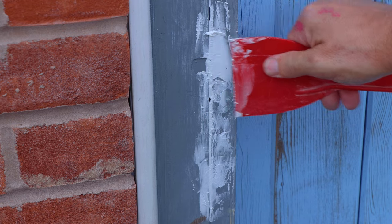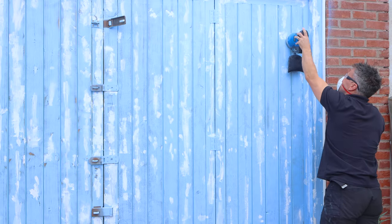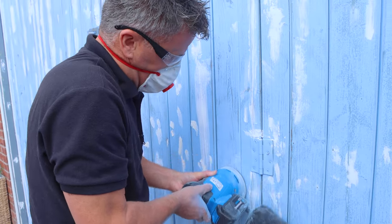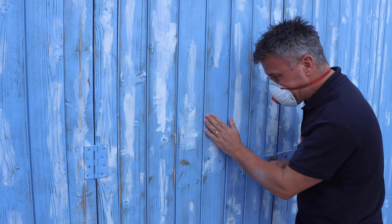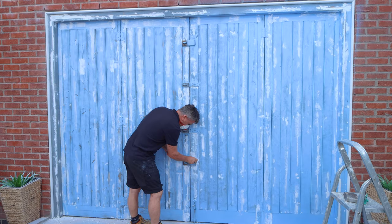I'm going to leave my filler overnight to fully cure. Now my filler is dry, I'm going to re-sand it so it's smooth, ready to paint. But as you can see, there's quite a lot of it — these doors are over 22 years old. In my opinion, it really is worth putting the time and effort in to do the preparation properly to get a professional result. Because remember, if you fail to prepare, well, prepare to fail. Have a good close inspection around all the door furniture and various areas, just in case it needs that extra little bit of sanding by hand.